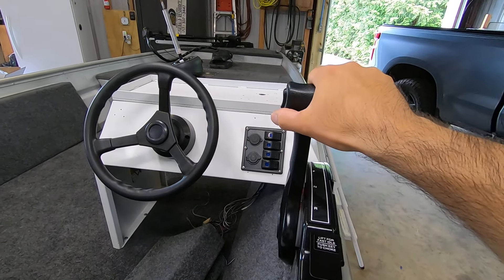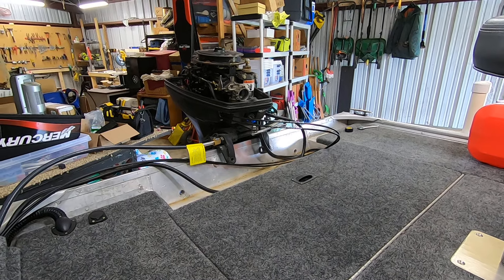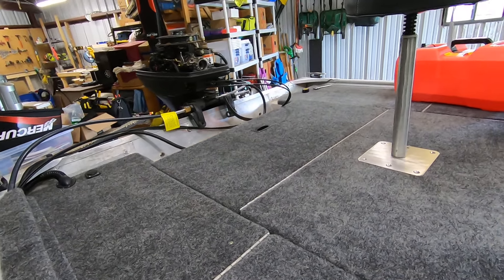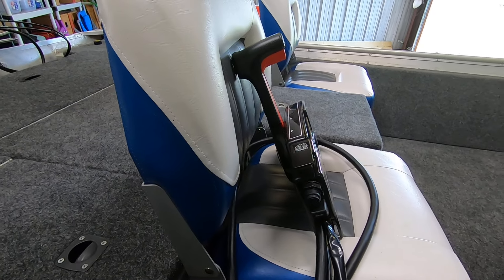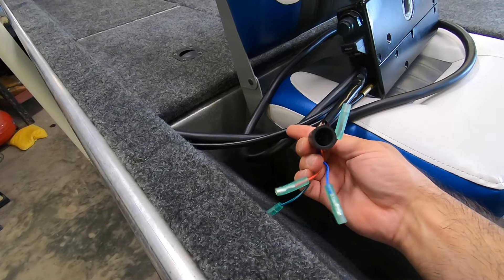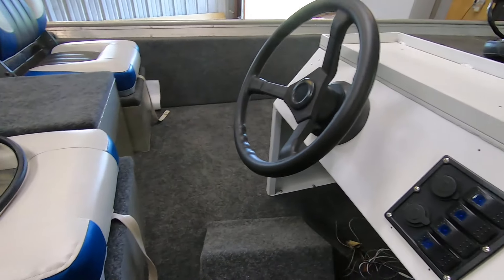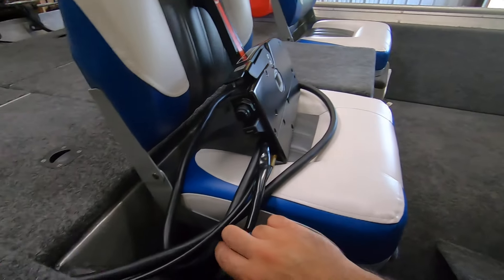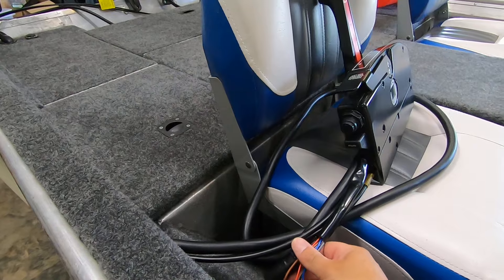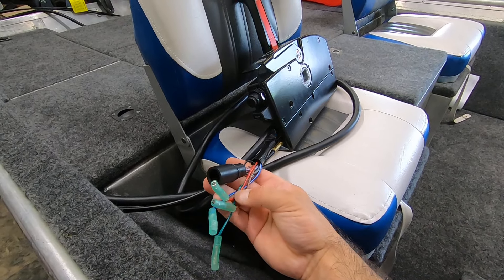All right, now we're back here at the throttle. This button here on the handle actually controls tilt and trim, so let's test it out — we'll go up and down. Very good, it's working. One part I didn't mention yet: these wires that come off of this throttle assembly operate any gauges you might have in the dashboard. Because we have a fairly simple setup here, I don't have any gauges, so these aren't going to be connected to anything. I'm probably going to tuck this back behind the panel with some zip ties just to keep it out of the way. We're just not going to be using it for this build.